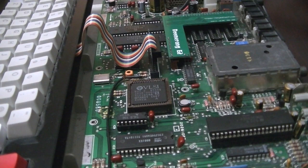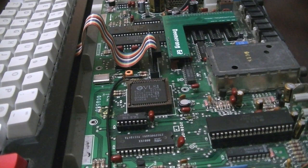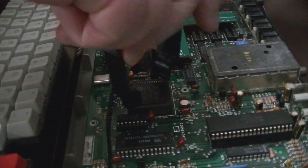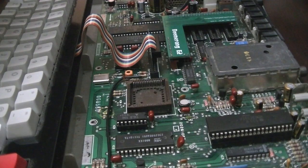To remove the GIMI, you simply get a PLCC puller like this one here. You definitely want to use that rather than try to pry it out by any other method — some of these sockets are old and brittle and rather tight fitting and you can actually crack the socket. Use the puller like this; there are two corners on the socket that will allow you to put the little jaws through. Push down to get it past the chip, otherwise they'll jump out and scratch the top of the chip. Once you're down past the chip, it's just a matter of squeezing the puller and it pops right out.